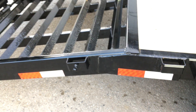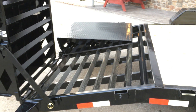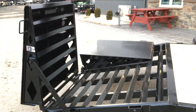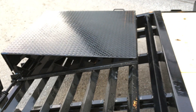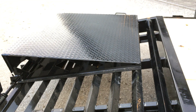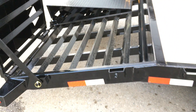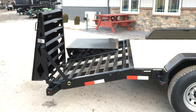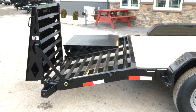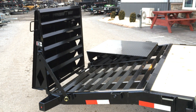There are stake pocket tie-downs, and back here at the rear you don't have a rubber rail because of the ramps — these are the full-width ramps that Lamar refers to as the rhino ramps. In the down position the benefit is it gives you a flat 22-foot deck with tread plate flats. It's got a self-cleaning beaver tail. This beaver tail style is in lieu of a two-foot beaver tail with a five-foot ramp — to keep that roughly seven-foot transition, you've got about a three-and-a-half-foot beaver tail and roughly a three-and-a-half-foot ramp, keeping the same ramp angle.